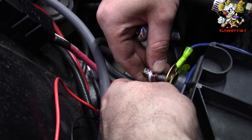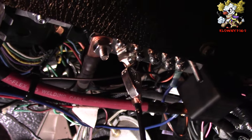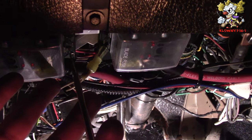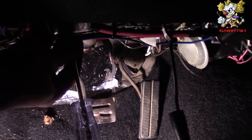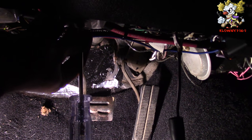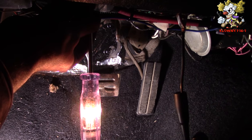Now we're connecting the battery positive back on and checking that all connections are good. I put a test light on the ground distribution block and the other end on the constant hot fuse block with a fuse in — the test light is on, so we know we're getting power there. Now for the switched on: once we turn the key to the on position, the relay puts power to the switched fuse block — and as you can see, it does. So now we have ground distribution, switched key-on, and constant hot fuse block. That's how you wire everything. Thanks for watching — subscribe, like, and share.